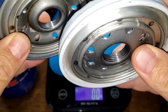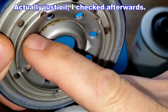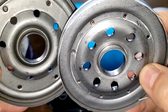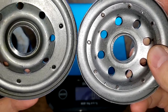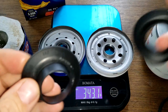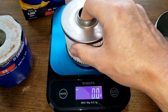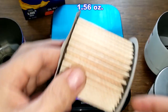The threads are pretty close. Notice the STP has a little rust here. The base plates are pretty equal overall. The inlet holes look a little smaller on the STP though. Both have nitrile rubber drain back valves that cover the inlet holes. Filter elements: Fleetguard 138.4 grams, STP 44.2 grams.